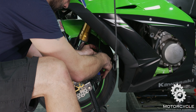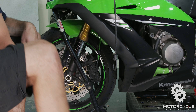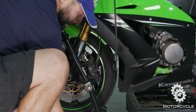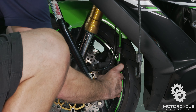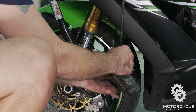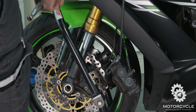This sometimes has a clip — this one's zip-tied. Either way, you're going to take off this line from your brake line. What this line is, is a speed sensor that goes down to this pulsar ring for your traction control and ABS. Separate them and rotate it in so you don't scratch your rim. Make sure to separate it. Then we have these bungee cords attached, where we'll just hang them right there on the bungee cord so that they don't hang from the brake lines.